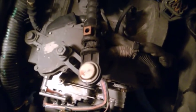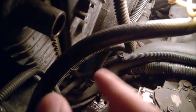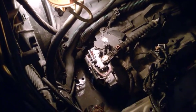And the place where I can reach, I just get a towel, put some brake cleaner on it, and just pass it along the mating surface. So you want it to be free of any oil. That's really important. Also, remember, when you put back in place the lines, clean them well, absolutely no dirt on them. Replace the lower seal, this one you don't need to replace it, but make sure everything is clean, otherwise it's going to leak. Good luck for this job.